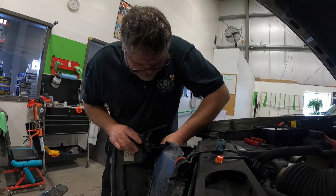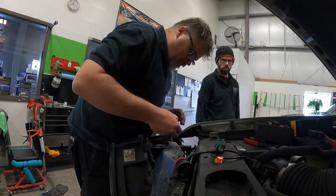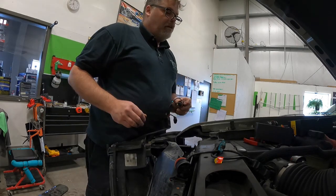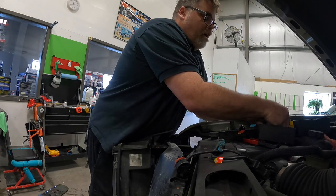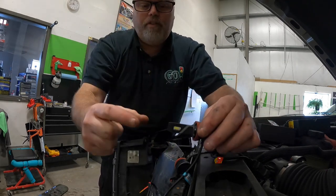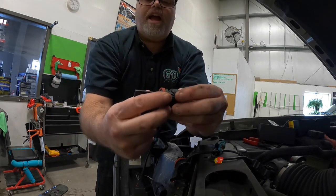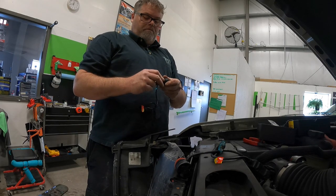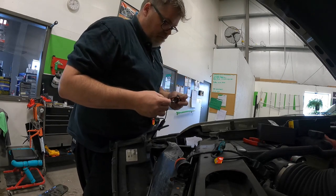Something's not right here — oh well, that's why. When you're installing these bulbs you got to make sure they sit a certain way. On the Chevy Silverado they've got to sit a specific way based on how the beam reflects. This thing is actually turnable with an allen key, so you gotta figure out where you want it and snug it up. This one was loose and that's why it wasn't tightening properly.